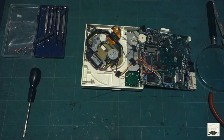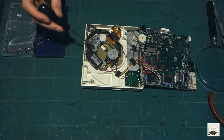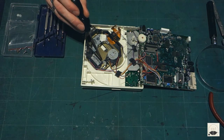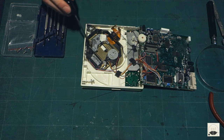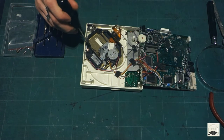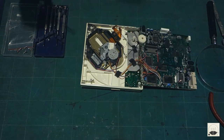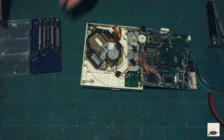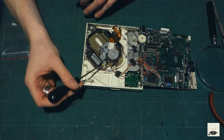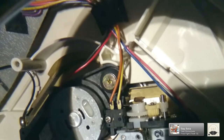So what I've seen on the internet is this area here — this spindle here — you see a tiny little bit of grease there, and I'm just sort of touching it now and it's flaking. And there's an area here that kind of juts out and you can put some grease down the back there. Now we can see straight away this gear here — that yellowed gear in the middle — that is the culprit. That's the gear that usually swishes and just breaks into pieces.